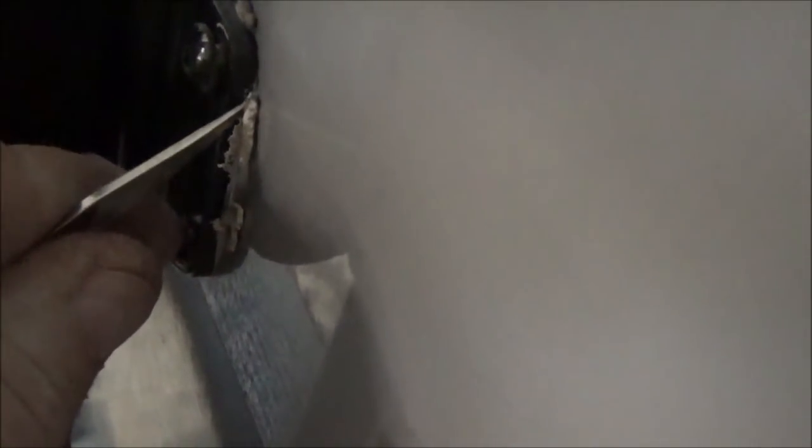There's a screw right here - I'll get some sealant on that. See this butyl? This butyl is dry and what happens is butyl can be your best friend or your worst enemy. When it's sealed up underneath it's okay, but when it's exposed and gets dry like this, it will actually suck water in and cause a leak - it'll pull the water in. There's nothing even on the top here. When you go around to seal your coach, make sure you get that - and do not use silicone. We've already went over that.